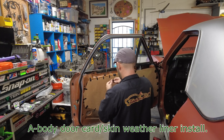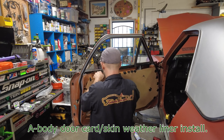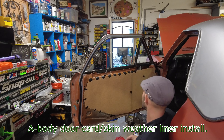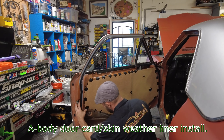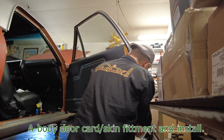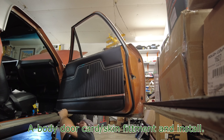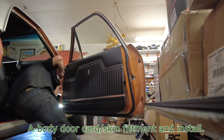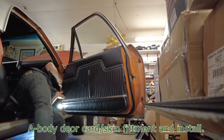I use some 3M weather-strip duct tape to secure this plastic/paper door liner — basically a waterproof door liner. I do recommend using these. I used tape because we're going to be peeling them off in the future and I didn't want to glue it all the way down. If it rips we'll buy a new set. This will be a little lengthy but you need to practice-fit the panel, make sure the clips are going to be in the right position. These clips needed extra glue to hold them in place, so I had to pull the panel off and on a few times. Take your time and make sure it fits right. I used 3M weather strip adhesive around the perimeter of the panel.